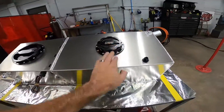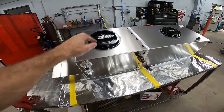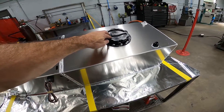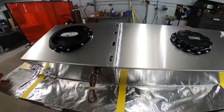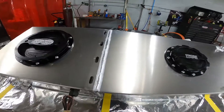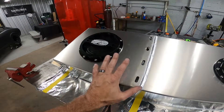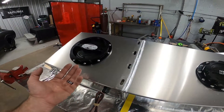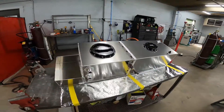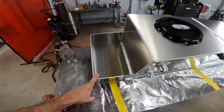Here's the basic overview: we've got fuel on this side, intercooler water over here. Tank capacities — we have seven and a half gallons for the water and twelve gallons for the fuel. In the middle you'll notice these holes right here. If you look inside, it is a double wall, so there's an air gap between the fuel and the water. For guys who ice their tanks down really good, you'll know it condensates like crazy, and this will help prevent condensation getting water inside the fuel.